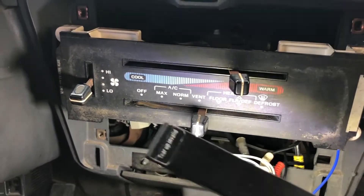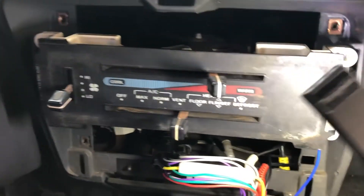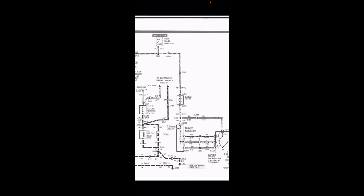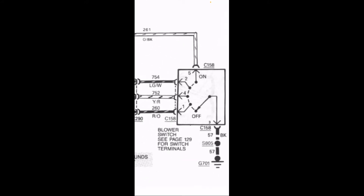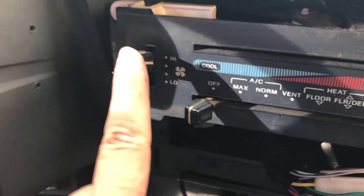The control circuit only goes from the ground side, but the blower fan always has 12 volts. So this is your HVAC electrical — the blower motor will always receive 12 volts through the brown or orange wire coming from the 30 amp fuse underneath the dashboard. The ground side comes from here and goes through the switch and also through the blower resistor, which controls the speed.